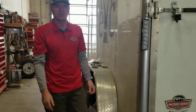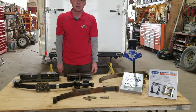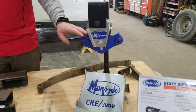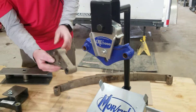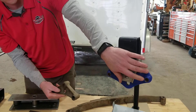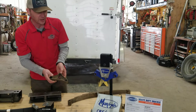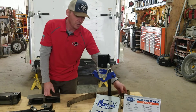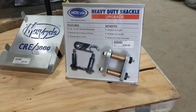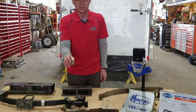Back on the table here, I do have a couple of examples of some upgrades for you. My parts manager tells me he's doing a 15% discount on these for the month of March. This one here has got some rubber bushings in there — this is your equalizer piece, and this is your hanger up top, so this just replaces your equalizer. It's got rubber bushings in there which will absorb some of the shock — one option to avoid costly failures. It's an upgrade that's going to give a better ride for your tow vehicle as well as your trailer. Down below, we've also got some thicker, heavier axle straps with bronze bushings, which will last a lot longer than your typical factory-installed nylon bushings.